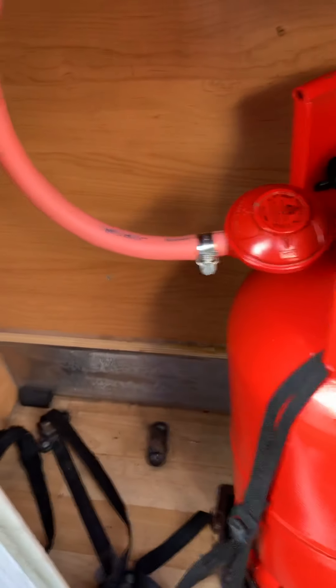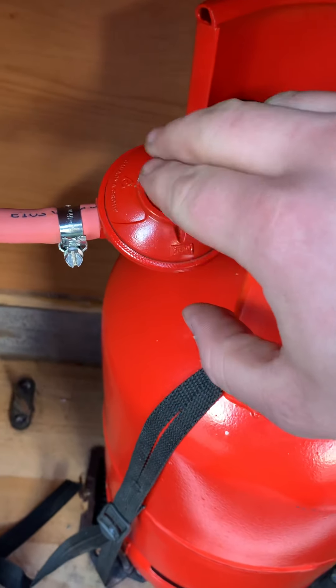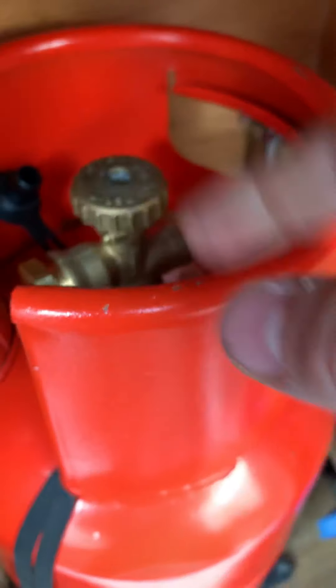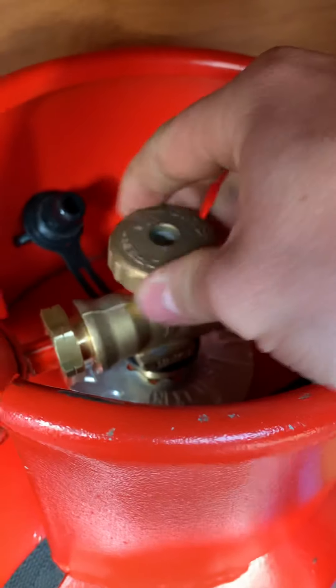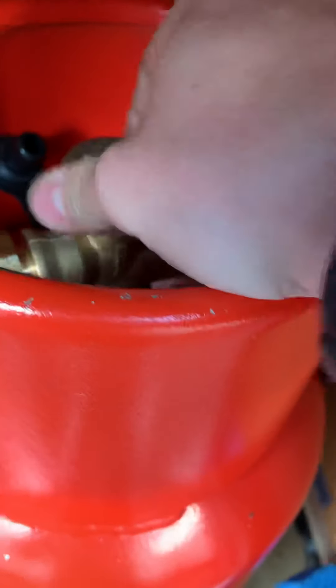The gas locker — you've got space for two six-kilo propane bottles or two seven-kilo butane bottles. However, you would need to get a different type of regulator if you want butane — this is a propane regulator. I've had to run a bit of new hose here because everything that was in here was totally out of date. You've got about five years on this hose and ten years on the regulator. To turn the bottles on, go anti-clockwise — anti-clockwise is on, clockwise is off. If you leave it all the way on, when you come to it you'll know it will only go one way, which is round to the right, so you won't get confused.